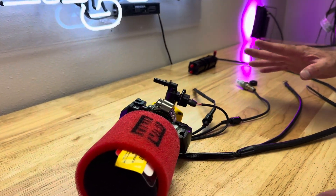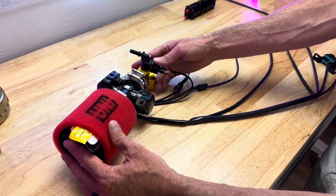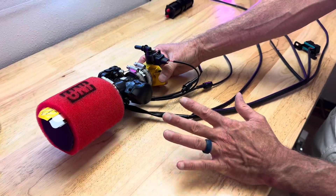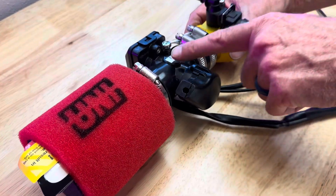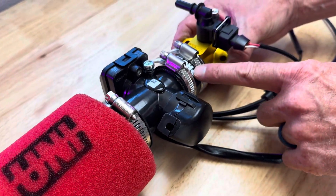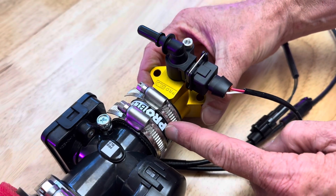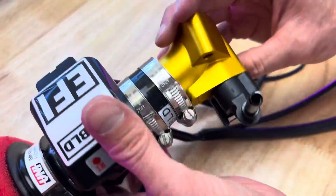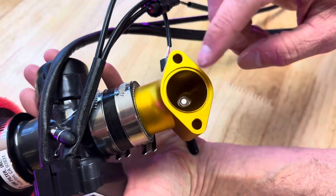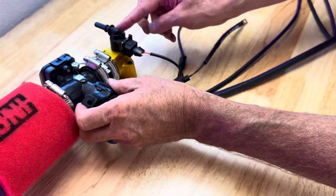Here's a raw and dirty view of basically the installation of the EFI system. Everything as you see it right now is the way you'll get it. Got the Unipod filter with the throttle body. It's got beautiful silicone — silicone so it doesn't crack. A lot of these are rubber on the market; ours is silicone. And we've got our 5-axis CNC'd intake manifold, 27.5 millimeters to match any big bore head. Got our fuel injector.